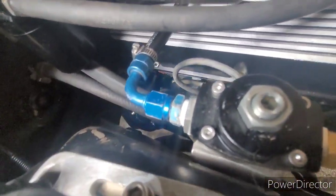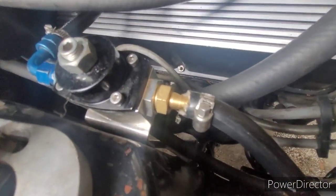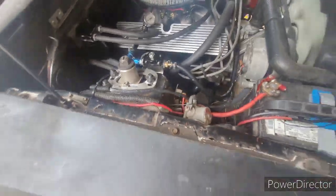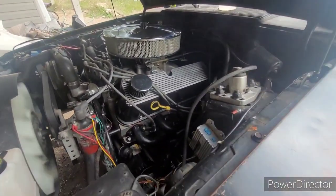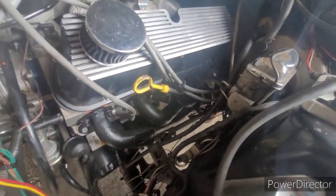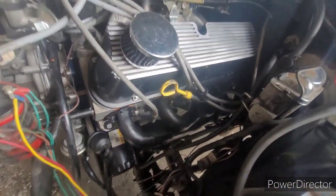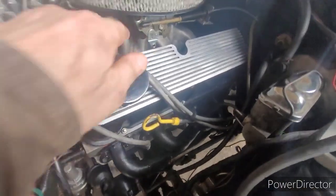We might have a slight exhaust leak over here. Once it's gone through a heat cycle, I'll tighten everything back down. Smoke them if you got them. Not sure how well that's showing up on camera, but the headers are smoking a good bit. Use the thermometer, check all the cylinders. Seems like every cylinder's firing. Not idling all that great.